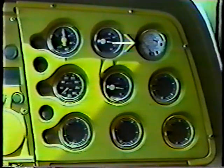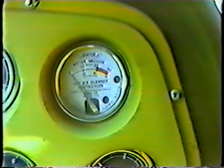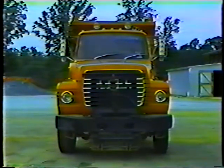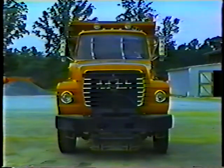Check your fuel. Check the air filter restriction indicator — if the needle goes into the red range, you'll have to clean or replace the air filter element. Make sure all of your lights are working: headlights, turn signals, flashers, strobes. Dump trucks are notorious for faulty brake lights — check to see that yours work. Test your windshield wipers and horn, and check the free play in the clutch pedal before you head out. Experience will tell you when a clutch just doesn't feel right.